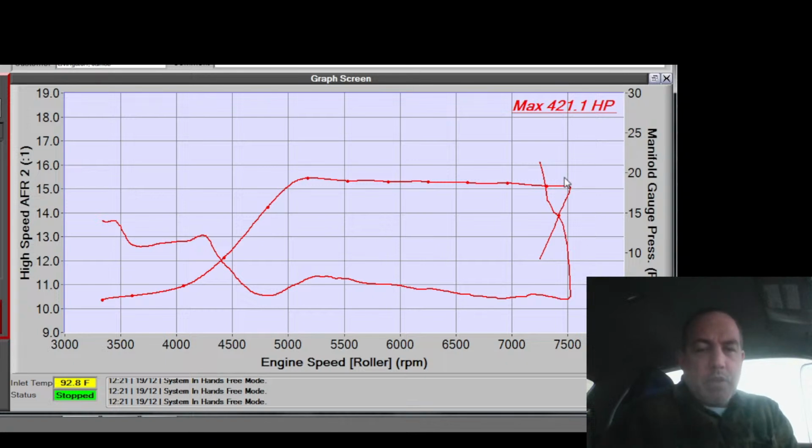All right. Well, I'm gonna add a smidge to the boost and have this boost go up a smidge on pump gas. I'm gonna have it go up a couple psi towards redline, and then I'm gonna change my cam timing. Again, that's 2 changes, which isn't a good idea to do to try and troubleshoot which one's which. But one of those changes is just putting the cam timing back to where it was before, so I don't think that change really counts.